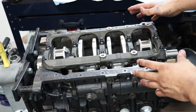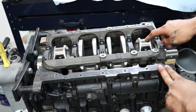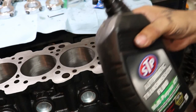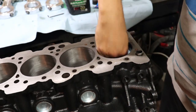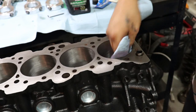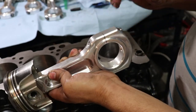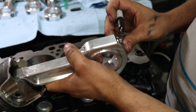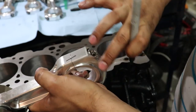We're going to flip it over and install the pistons and connecting rods onto the crankshaft. We'll test bearing clearance with plastigauge. I usually use ATF to lube up the cylinder walls before putting the piston in — transmission fluid stays on the cylinder walls a little bit longer than motor oil, which is great if you're going to let the engine sit. One more thing: before taking off your connecting rod caps, always mark them — if you mix up the caps the bearing and rod will probably seize. I use a permanent marker to mark a line on each one.